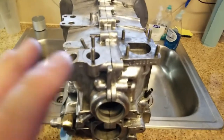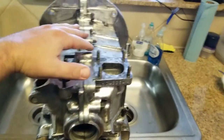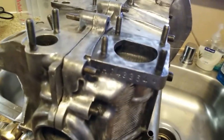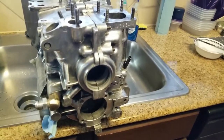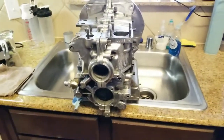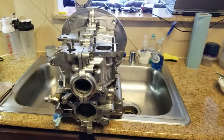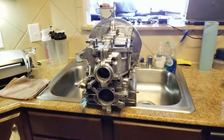Those of us that know — the only parts you're probably going to be seeing on this thing are from the oil dipstick up and then this area in here. Jewelry — super shiny. I went ahead and cleaned up here so you could see the AH on the actual engine case. Got our full flow tap — I'm just going to leave that on here, there's no reason to take that off. We're ready to crack this case and then clean it up and stick it into the dishwasher for a final rinse and clean. After I get done doing this, I'm going to clean the crank like I was saying, and then we can go ahead and get the garage cleaned up and get the surgical area ready for reassembly of the engine and get my long block back together.